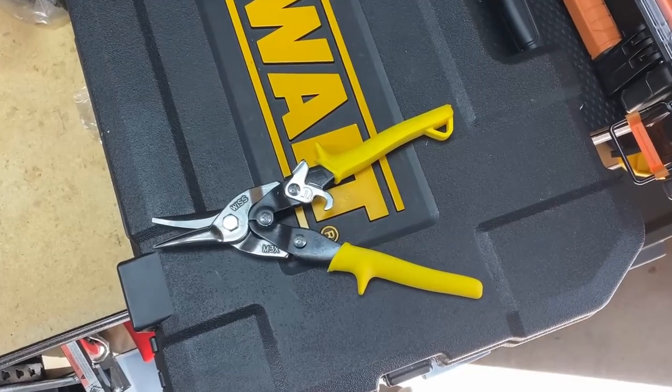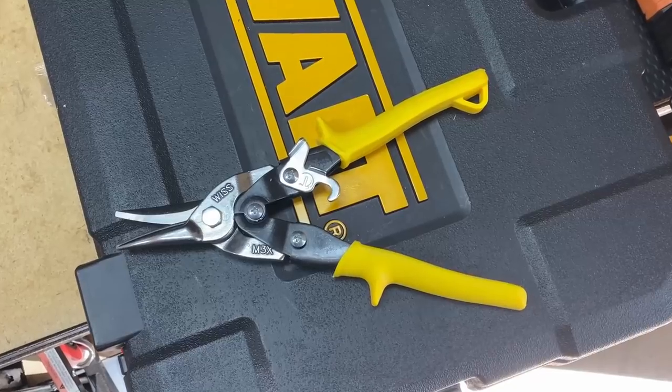Tip three: make sure your jigsaw is set to have the blade go straight in and out and not in a circular orbital motion. Tip four: do not let your jigsaw battery get low — if you're using a cordless jigsaw and the battery gets low it's going to lose power, catch on the metal, bounce out, and cause dents. Final tip: instead of using the Dremel for those little extra minor braces around the window, use metal shear snips. It creates way less mess. You do bend the sheet metal a little but it's all going to be covered up anyway.